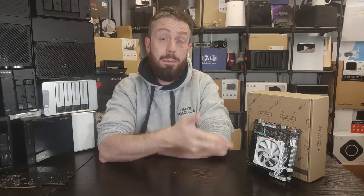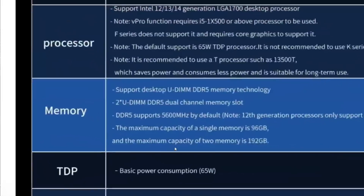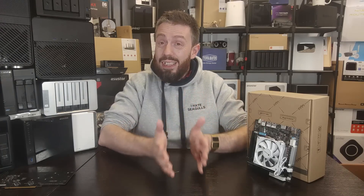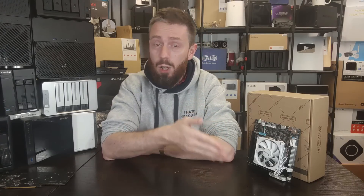There's a great deal to like for serious NAS builders in this board. The eight bays of storage - tick, tick, tick. The three M.2s with the right customization and CPU of choice are going to be beneficial. We also have to acknowledge that UDIMM memory support means larger amounts - according to the manufacturer's specifications, heavily dependent on CPU choice, you can support up to 96 gigabytes of memory per slot, bringing up to a total of 192 GB of DDR5 memory. Keep in mind you need at least higher than an i5 12th gen for 5600 MHz memory, and ECC memory support is going to be massively dependent on your CPU of choice. We're going to be setting up this board in our long-worked-on Silverstone CS382 case with Icy Dock caddies to see just what a board like this can bring to the table.